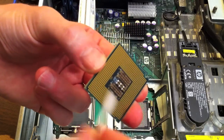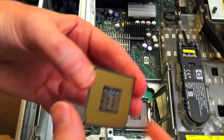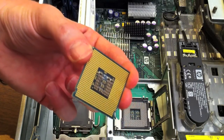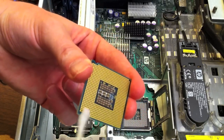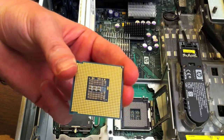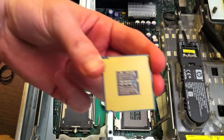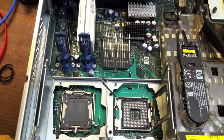You want to get all your fingerprints and junk off of there so you make good contact. Just go around it and clean the contacts — I'm not going to get aggressive about it. If you notice there's some junk on there, you probably had a non-functional processor to begin with, but you might use a pencil eraser — works very well — to clean off those gold-plated contacts.